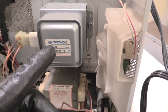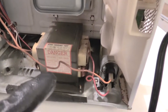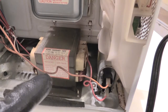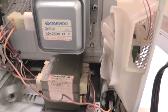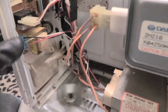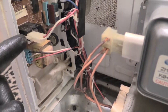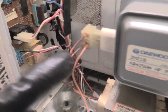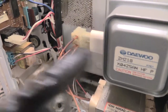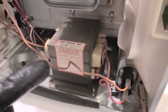Once inside, here's a quick run-through of the components. This right here is your magnetron — this is what actually creates your microwaves. This down here is your high voltage transformer that supplies power to your magnetron. Then you have your low voltage transformer right here, as well as a relay right here. Sometimes when this relay goes bad, it'll cause your magnetron not to work because the relay is not sending power down to your high voltage transformer.